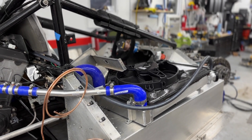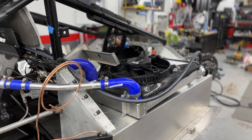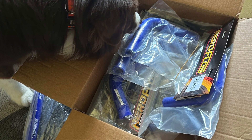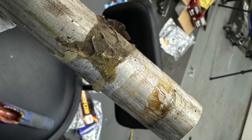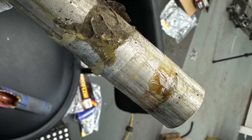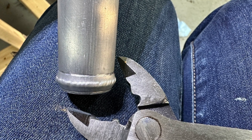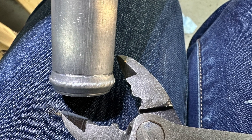So my goal was to reconfigure the coolant system more like most OEM systems. I also replaced all of the hoses with some from Aeroflow, an Australian company that I found that had really good pricing. Another thing that I did was when I inspected all of the aluminum coolant pipes I noticed that they didn't have any beads on the end, which would increase the risk of a hose popping off. So I took some electrical crimping tools, modified them slightly based on a YouTube video, and was able to hand-bead the ends of all of the pipes.